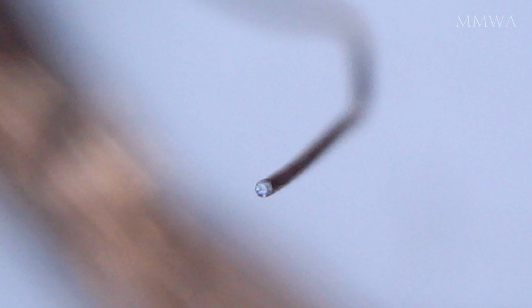If you look at the end of that cross section, it's actually copper plated aluminium. You can't even solder this. It basically boils the copper off after 10 seconds and turns into a mess, and it cannot be soldered. Just be warned, this crap is out there.